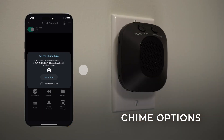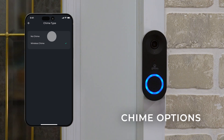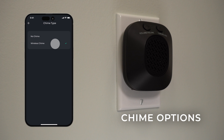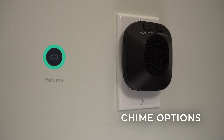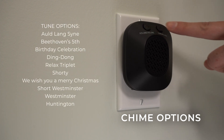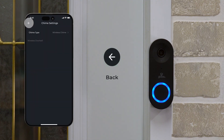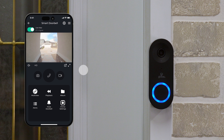On the Globe Suite home screen, select the smart doorbell to access the device's controls. You will be prompted to confirm your chime type upon first app use. Tap 'Set it now' or return to the option at any time by selecting Chime Settings at the bottom of the screen. Tap Chime Type and choose 'No Chime' if you are not connecting the button to a chime, or select 'Wireless Chime' if you are using the included chime. To control the chime's volume, use the volume button on the physical device. To change tunes, press the music button to play through the available options, then press the doorbell button to lock in the selected tune.